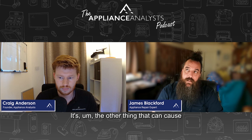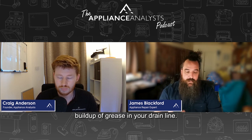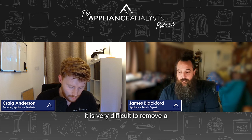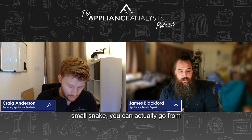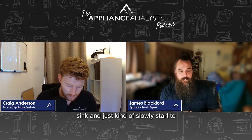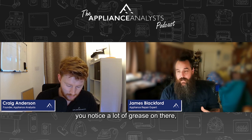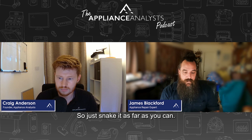The other thing that can cause it not to drain is if you have so much buildup of grease in your drain line that it's just not going anywhere. Mm-hmm. One thing that you can do, because it is very difficult to remove a dishwasher sometimes, is if you have a small snake, you can actually go from where your drain line hooks to your garbage disposal or underneath your sink and just kind of slowly start to run that snake down the drain line. If you start to feel a little resistance and you pull it back out, you notice a lot of grease on there, most likely that's what's going on. So just snake it as far as you can.